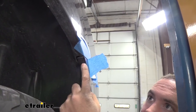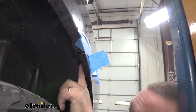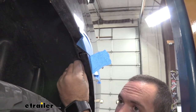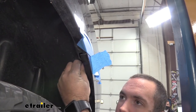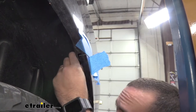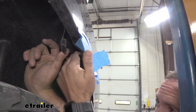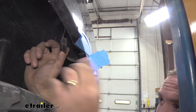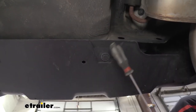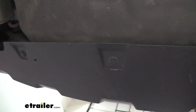At the top corner where the fascia meets the rear quarter panel there's a push pin facing up — take your screwdriver or trim panel removal tool and pry that out. Sometimes peeling back a little bit of the inside liner lets you get to the top part of the clip and push down to initiate the first pop. Underneath the vehicle in the center part of the fascia there are three plastic push pins — go ahead and remove those.